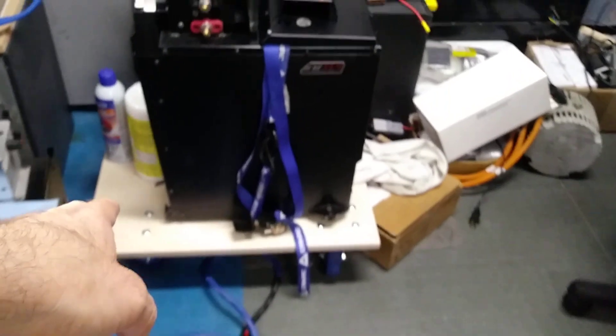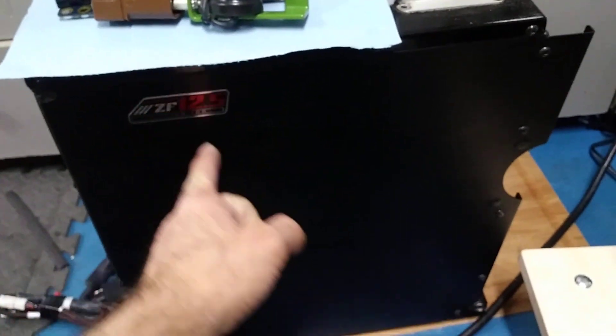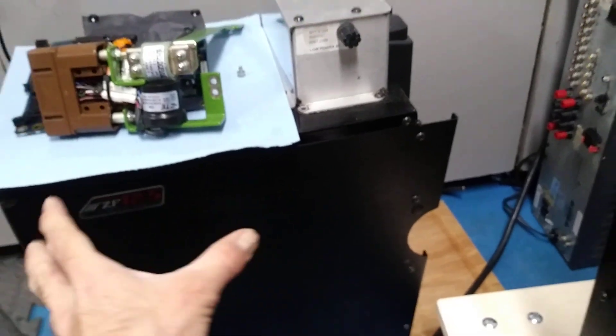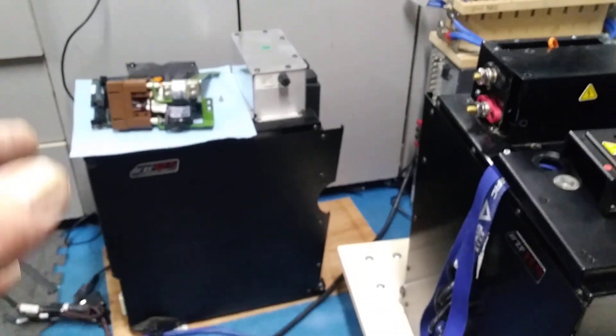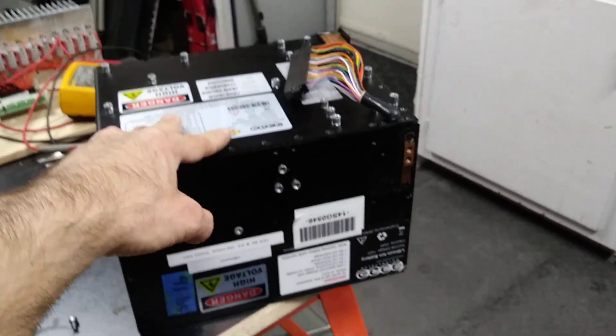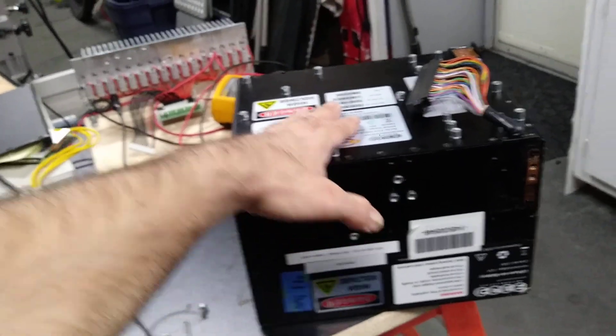To power this, I had a solution — I've got a few Zero battery monoliths. In the 2016 and lower models, there are four bricks inside, and those bricks are the same voltage as the entire monolith: 28 cells in series. This is one brick I've just disassembled — you can see the connector, contactor, the big fuse, and the BMS.